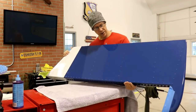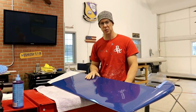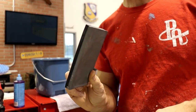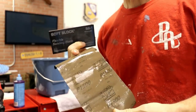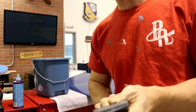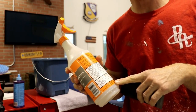The side I already did looks really really good, and I'm going to try to sand this side too and eliminate most of the orange peel. The first step is using a sanding block like this from the local paint shop — you can use a piece of wood or whatever you want. I'm starting with 1500 grit sandpaper. I do have 1200, but the orange peel isn't too bad so I'll start with 1500. I also have a spray bottle from Home Depot with just water and Dawn dish soap.